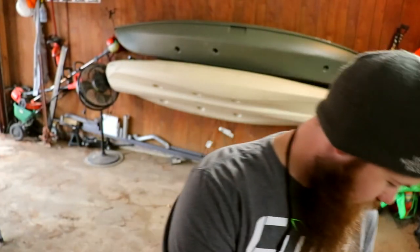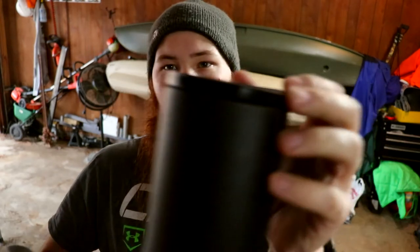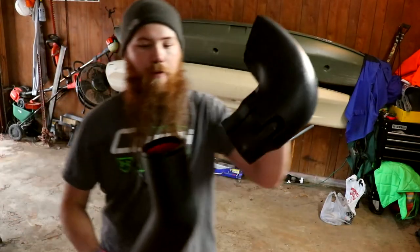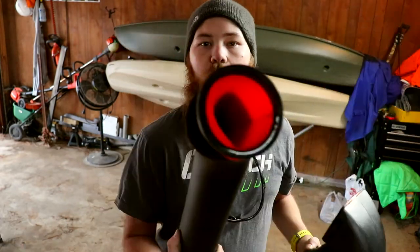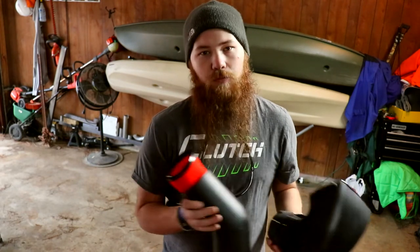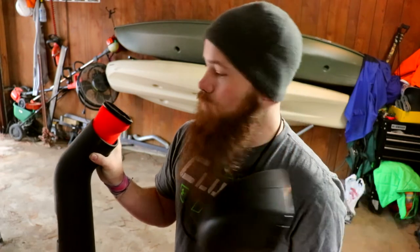This is unexpected — I was hoping this would come in today. Overnight parts from Australia — well, not overnight, like two weeks. Hayden Gooch, thank you Gooch. Unifilter Australia. So that filter I was talking about earlier — this is it. There are three of those filters and they're oiled too. It just drops in there, sits nice and flush on top, then you put your cap on, put your clamp on that bracket, and it holds it all down. That's essentially your filter. I couldn't find these anywhere in the United States — I searched far and wide, and the only place that sold them was Unifilter in Australia, which is also what I use in my four-wheeler. It's a great brand, great filter. I couldn't figure out why they don't sell these drop-in snorkel filters here in America.